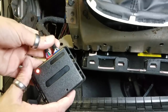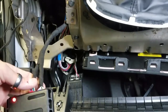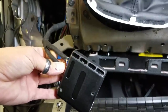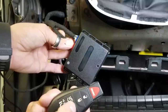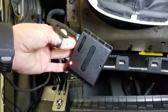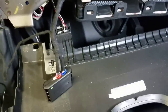If it's already ready for programming, it's going to turn orange. Take the key, insert it into the ignition, turn it on — you'll see it start blinking green. Turn the ignition off, hit the unlock button, and it will turn solid green then turn off. That's it. Now hit lock three times and it'll start. We're running, parking lights are on, we're good to go. Hit unlock, walk out, get in, put the key in, turn it forward, and you can drive away.